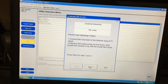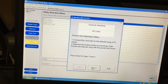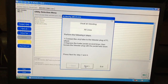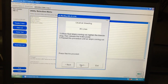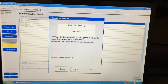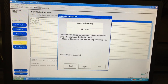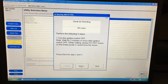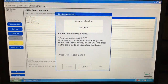Start with the front right, then repeat the same step on the front left: depress and hold the brake, release the bleeder plug, close the bleeder valve back, and repeat the procedure multiple times — about 20 times — to ensure sufficient fluid volume and no air. Hit Next, assuming the front wheels are complete. This part is pretty much a conventional fluid change like on any system.